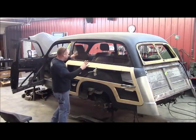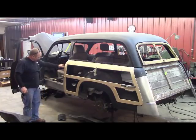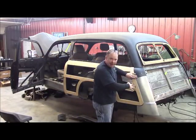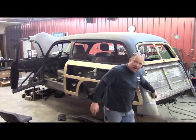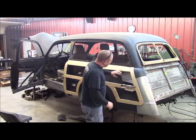I just kind of put this in the center of all the metal work I did by pulling the sides out and moving the door pockets. Right now where I'm at - I locked this down to the front and it's just perfectly fit from where we did that before. Then I ran this straight on out, secured it all down, and fit it here again. Now I'll be able to tune this side of the panel. I got that side of the panel tuned all the way down to the door seal in between the gate and the body, and that's all going to be right on the money.